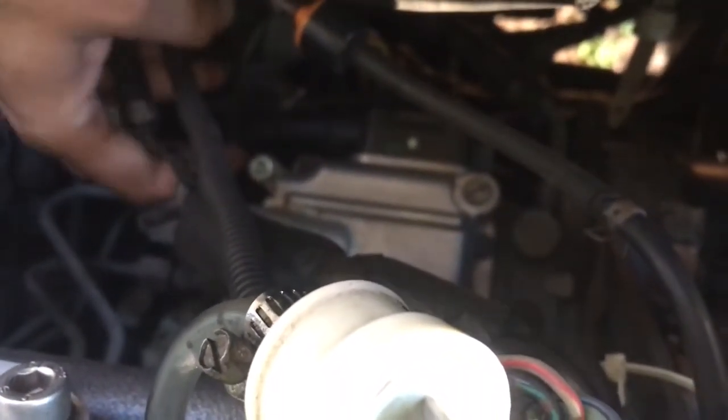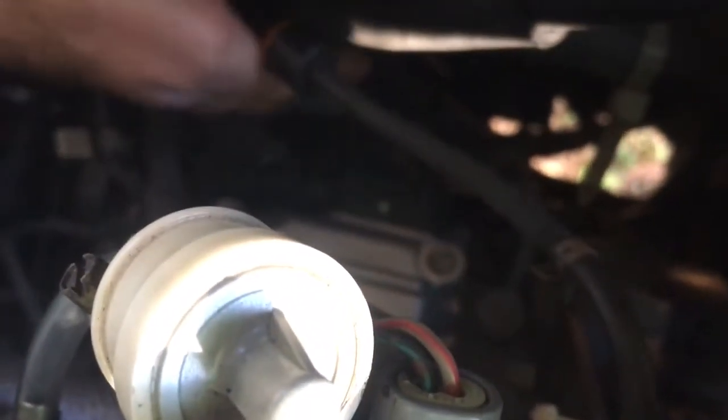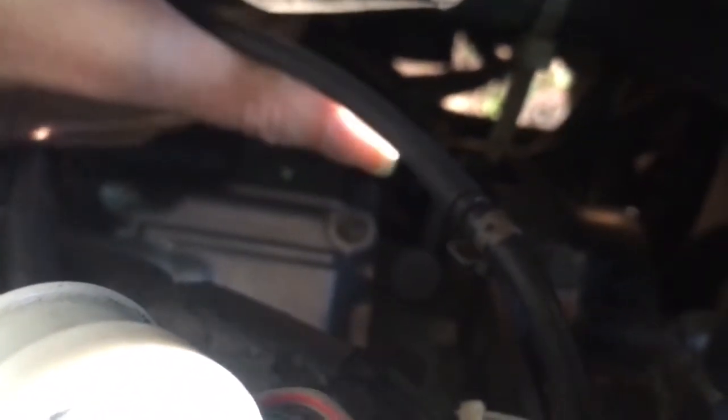Some cars have an electronic bit here — there's a cord here that may need to be checked and cleaned. That can cause high revs or non-idling issues. This is a fly-by-wire vehicle, so here's another issue here that can cause it. I'll try to show you before I turn the video off.